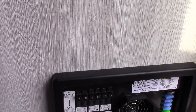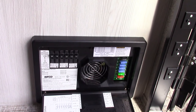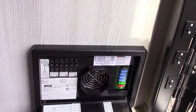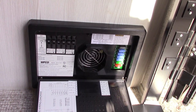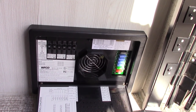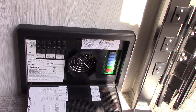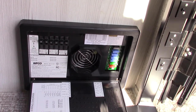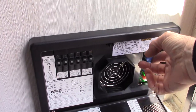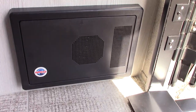The converter also does one more thing: when you're plugged into shore power, it will charge your battery. As long as you're plugged in, it senses how much energy your batteries need — if they're totally charged, it'll just trickle a couple amps; if they're low, it'll send 10 amps or whatever's needed. Also, if any of these fuses were to blow, they'll actually light up and glow, and you can see them through this perforation, so you'd know you blew a fuse. That's the converter.